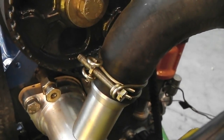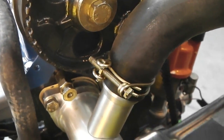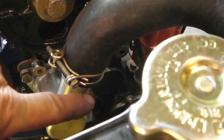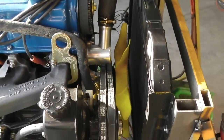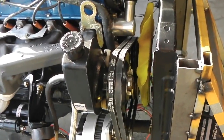This is what it's all about. This is the whole point of the mission. I'd be surprised if that's the gasket. I'm going to say it's just finding its way out. Yep, I can see the steam. So this top hose there, not quite secure. So there's our first little one. But you'd expect stuff like that to happen. That's not a big game changer. We just get the spanner on that in a minute and nip that up.